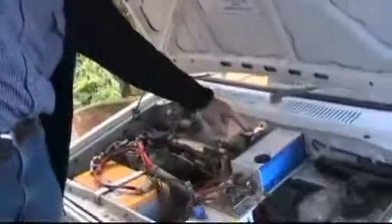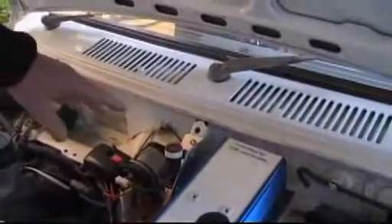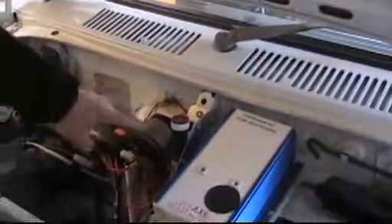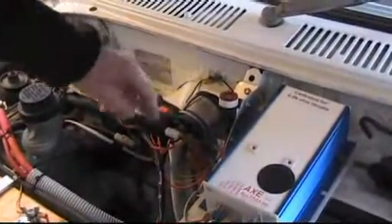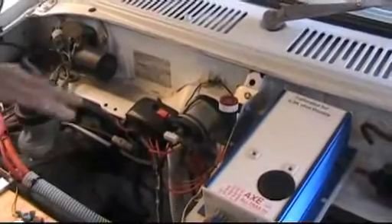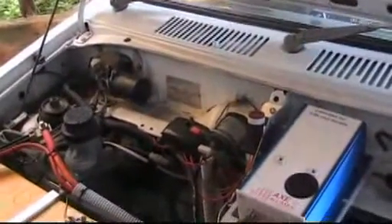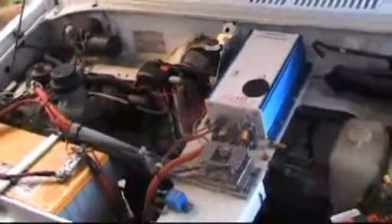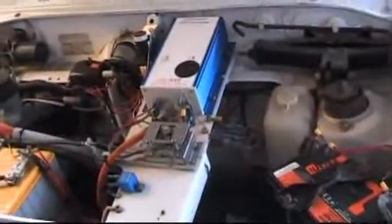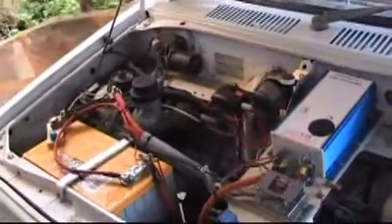There are a lot of fancy switches. There's an inertia switch there which, if you're in a collision, shuts down all the electric circuitry. There's a solenoid here which, when you turn on the ignition key, livens up the high tension circuit. So there's a lot of safety stuff built in, but it's just a daisy chain of little switches and relays — each one is simple in itself — and if you just start at the beginning and go to the end, you arrive at an electric car without any great hassles or headaches.